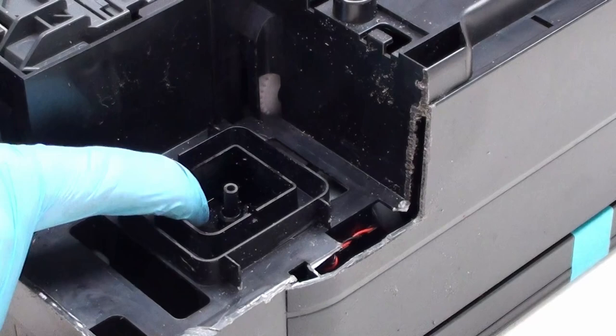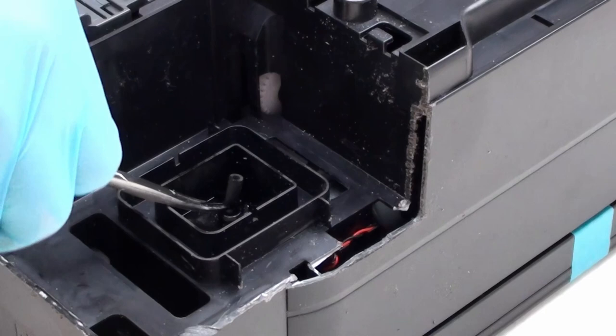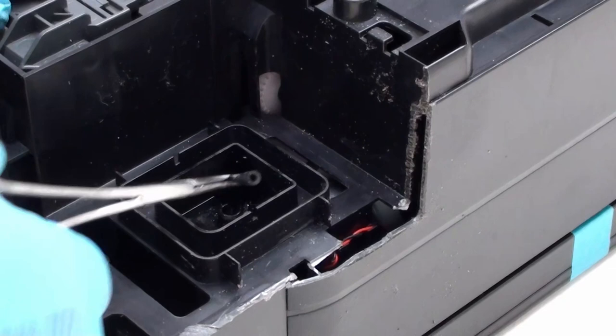You have some excess capacity, but you do not want to pull it out like this because you're stretching the tube and also you're running the risk of that tube snapping off the connection fitting inside on the pump. If you break off the tube internally, that's it — game over — you're not going to be able to fix that without taking the entire printer apart.